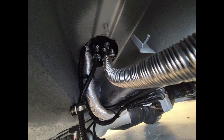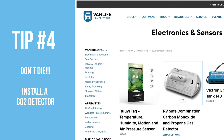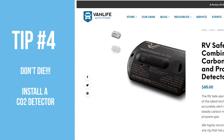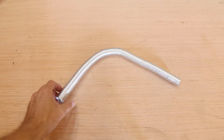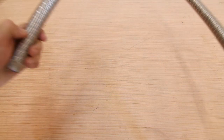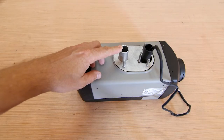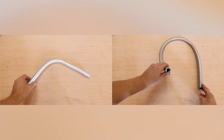And there's the combustion exhaust — the metal one. Once installed these will be on the exterior of the van below the floor, which prevents any combustion gases from getting inside your van. That's tip number four: anytime you have things that use combustion inside your van, like a Webasto air heater, please install a carbon monoxide detector. We sell an affordable combo unit that detects both carbon monoxide and propane gas.